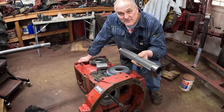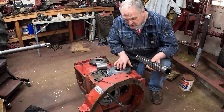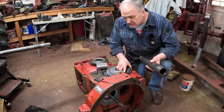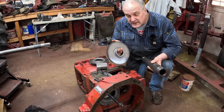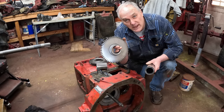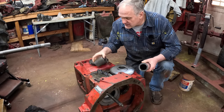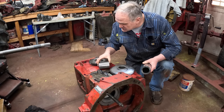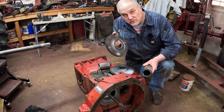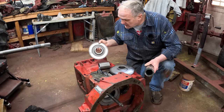The next thing is to put in the transmission counter shaft - this spline shaft that goes in the lower part of the transmission. It has two primary parts. First, the two constant mesh gears that engage with the two gears in the torque amplifier. The first is the torque amplifier driven gear - the TA drives this gear when you're in TA mode. I had to get this gear supplied with the TA to make sure it meshed properly. Then there's a long spacer, and then the direct drive gear, which runs off of the quill gear and also has the transmission brake on it.